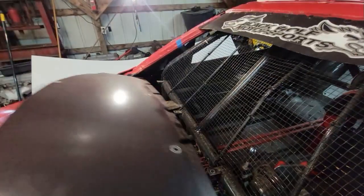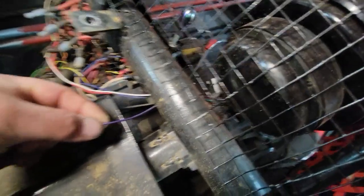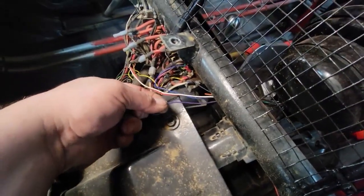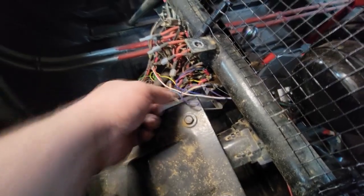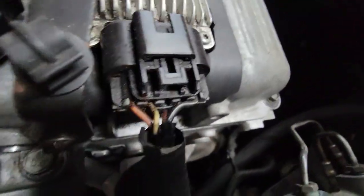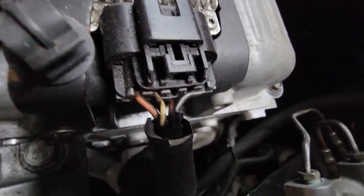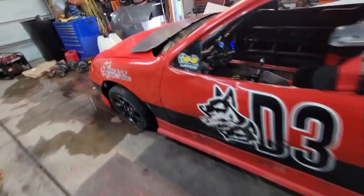To make that one work, there is a purple wire that comes from the TAC. You connect that purple wire to the white wire on the ignition coil on the engine, which I will show you. You can see that white wire there — it's kind of cruddy looking because it's got some oil on it, but you get the point. Run a wire from that white wire on the coil to the purple wire on the TAC. That's your signal wire.